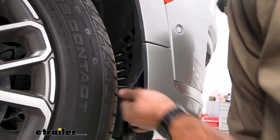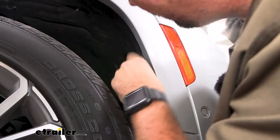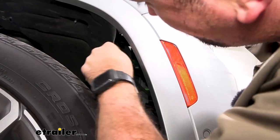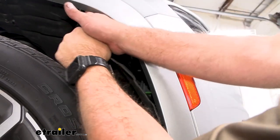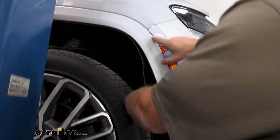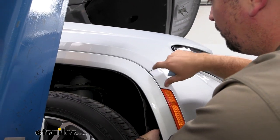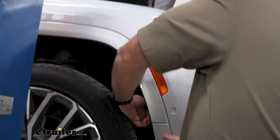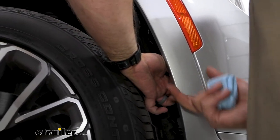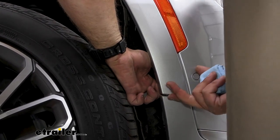This should allow you to get the fender liner pulled out — you'll know pretty quickly if you missed any hardware. Just kind of peel this back. Once you peel that back there are going to be some clips, and we're going to be removing this back to a certain portion. The main thing we're looking for is to get to the hardware where the fascia attaches to the front quarter panel. Just be careful — you don't want to peel it back too far, as that can cause damage to the paint and crease it, so just take your time.